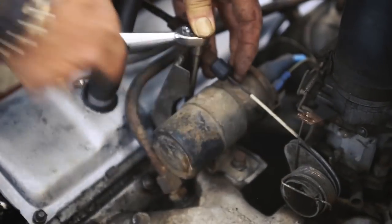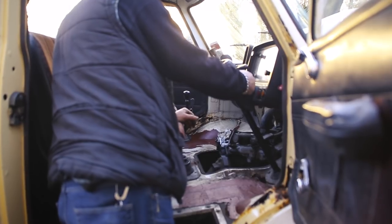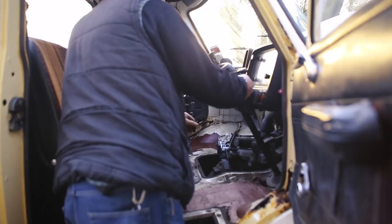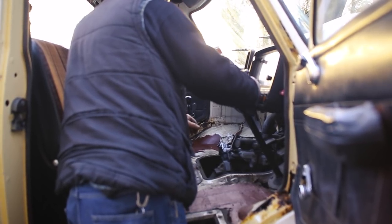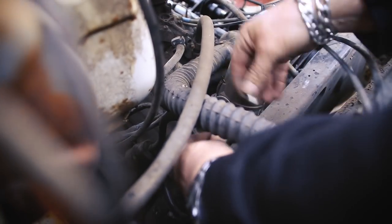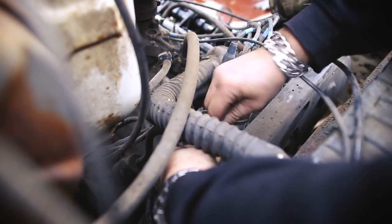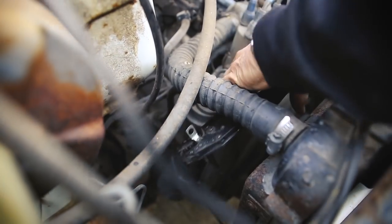All that was left was to reassemble the engine and give it a try. It still wouldn't start, and we were at a bit of a loss what to do next. Thankfully, Lucy's dad noticed a loose earth cable hanging in the engine bay and promptly repaired it.